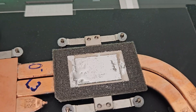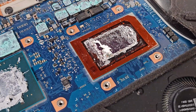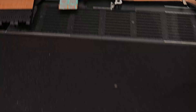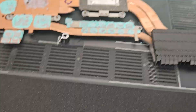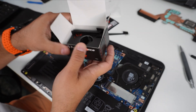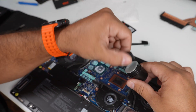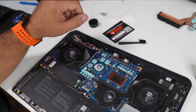This is the heatsink side as well — as you can see, pooling up in that corner right there, and pooling up in the same corner here. I'll have to clean up the GPU paste here and repaste all of these VRMs, both on the heatsink side and also on the motherboard side, but let's just clean up this liquid metal before we start reapplying the PTM. I'm gonna have to put some thermal putty in there as well, because I took it up a bunch of times and never did bother to replace it. This is also expensive, but definitely needed because it's crusty and gone.